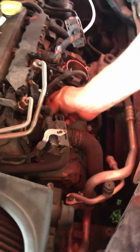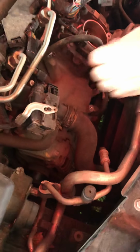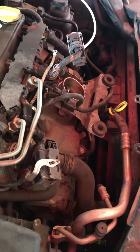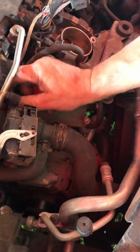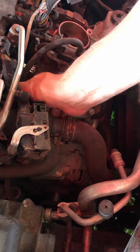Again, 16 foot-pounds. This is now our new ground that we will add back to the module. Take place of this ground, which is very important. We've already discussed that. All important ground. Now we're going to take our 3 supplied isolators, and these pretty much we just hand install. See our 3 isolators. Put them in this position. These are already threaded correctly, so they just go in snug.